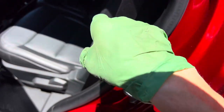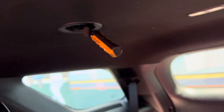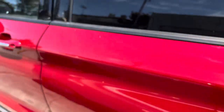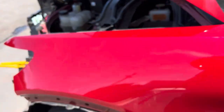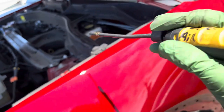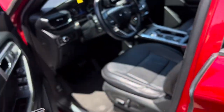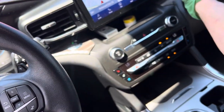Now we're going to take the clamp I have above the muffler on the suction line and remove it from there. We're going to move it way up on the rear line to see how much heat energy has been absorbed just in the line running from the rear evaporator all the way up to the front.